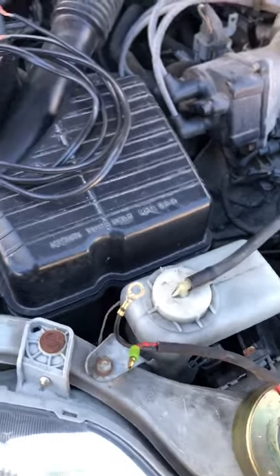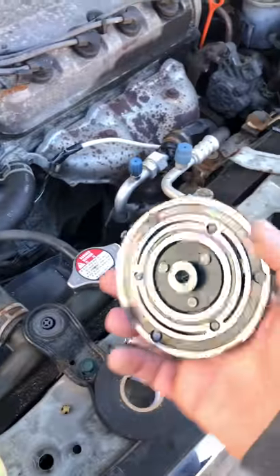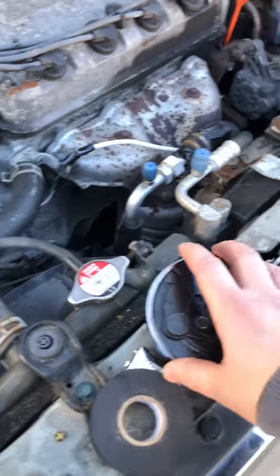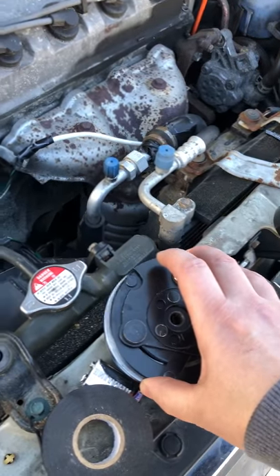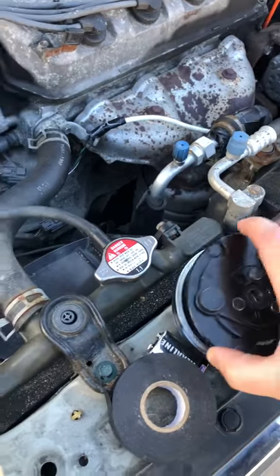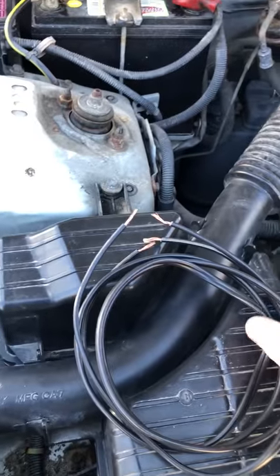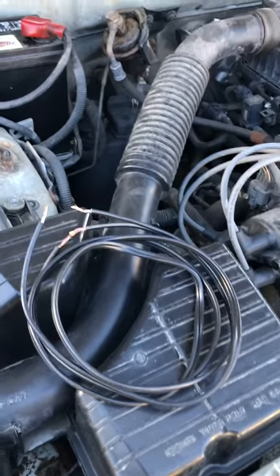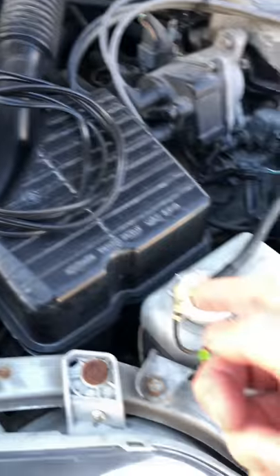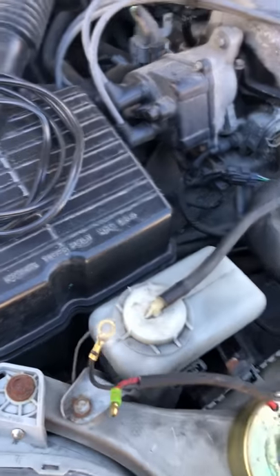I did this to see if the coil was actually working, since I couldn't hear a clicking sound to tell if the clutch would pull in till the pulley — because it's supposed to just pull into it to engage. Under this surface here, I just got some cable from a lamp or something, or from Home Depot, connected it to the negative terminal and the positive terminal using some electrical tape.